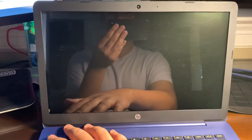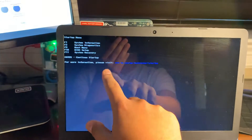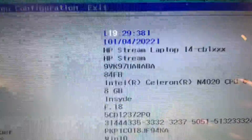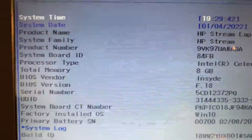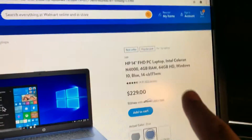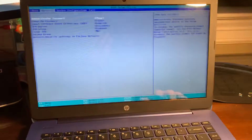I'm going to turn this on. Here's a cool trick: on HP computers, press Escape on startup and it halts and shows you all the hotkey options. I'm going to go to the BIOS setup — that's F10. As you can see here, 8 gigabytes of memory has been registered. Total memory: 8 gigabytes. So I have indeed upgraded from the advertised amount to double that.